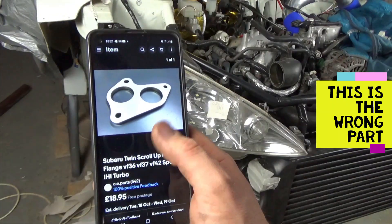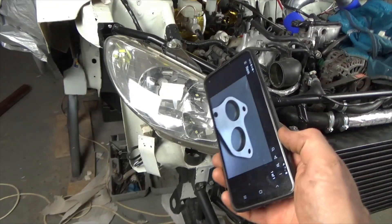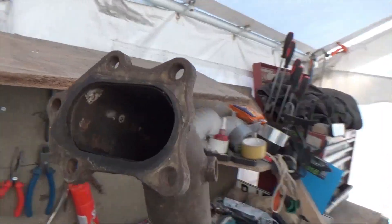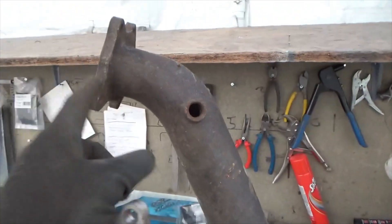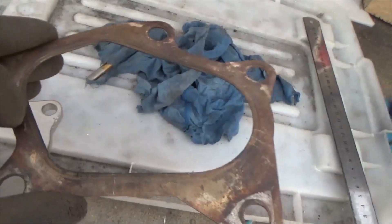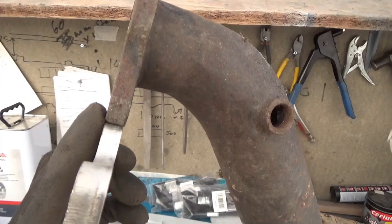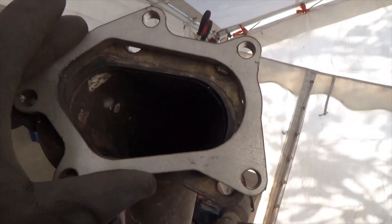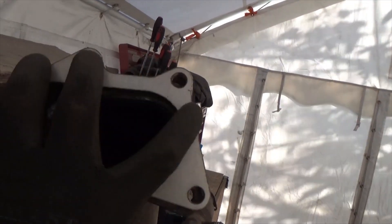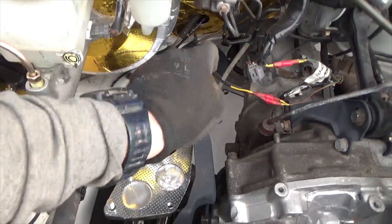If I buy another uppipe flange which is 10mm thick plus another gasket, all I will need to do is get longer studs and then it can bolt straight on. This means I don't have to cut the header or the uppipes, so everything is bolt-on and reversible. On the same theme, back to the downpipe down to the cat — a better option is to just replace the flange. This is the gasket from the IHI turbo; this flange is slightly bigger which actually works out well. As they are both 10mm wide, I can cut out the internal pattern of this flange and slide it over the existing one so it can be welded around the back, allowing me to retain the nice edge that will bolt up to the turbo. I will do this once I have sorted the engine mount, turbo, and uppipe, then I can get the downpipe aligned underneath the car.